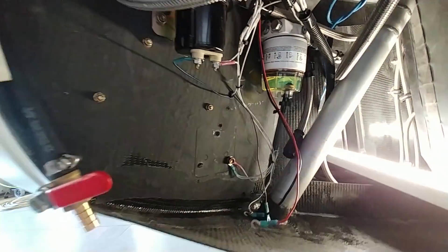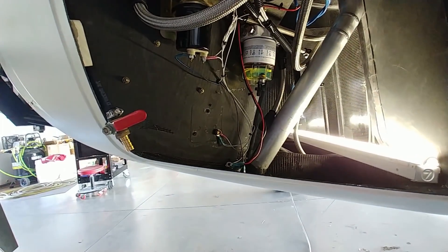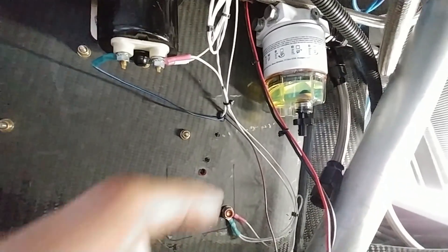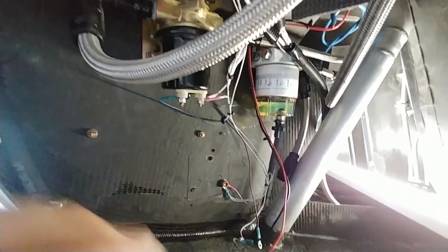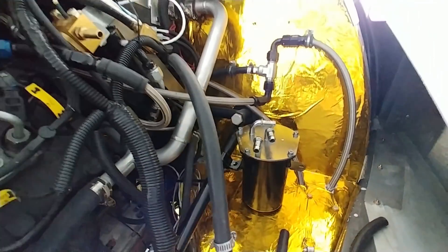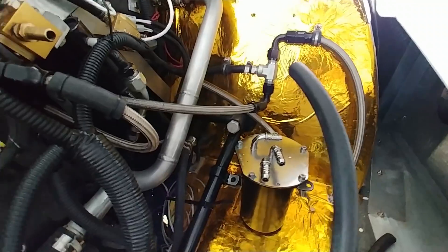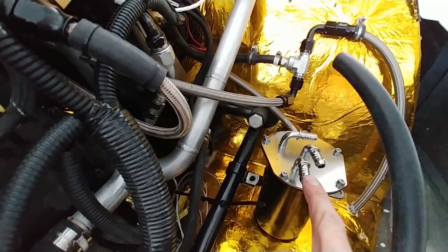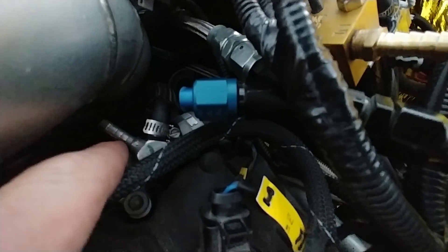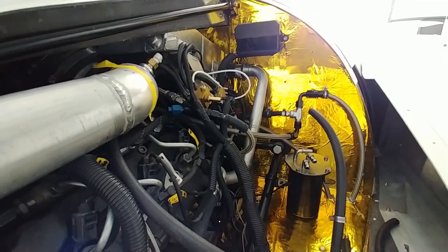Because that pump only went up to about 25 psi I've pulled it out, and the new one isn't coming until Monday since it has to come from Summit Racing in Ohio. When I get that in, I'll probably have to move a couple of things because this new pump is an inch and a half taller. That's kind of ruined my plan of getting everything ready by the weekend — it'll probably be late Monday before it's all hooked up. The filter is going to live around about here; it's got three connections — one goes up to the main feed, one goes to the return on the rail to provide back pressure for the injectors, and the last one goes to the lift pump.